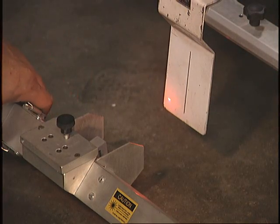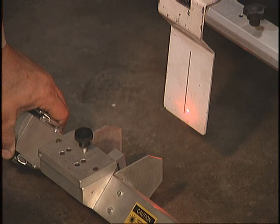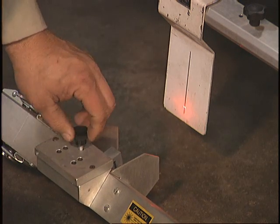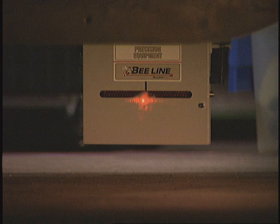At this point, go to the rear of the truck and turn on the laser. Slide the tube left or right on the cradles until the laser goes through the vertical slot on the rear target. Now, using the vertical alignment knob on the laser tube, aim the laser so that it hits the front target. A red light will illuminate on the front target indicating the laser position is being recorded.